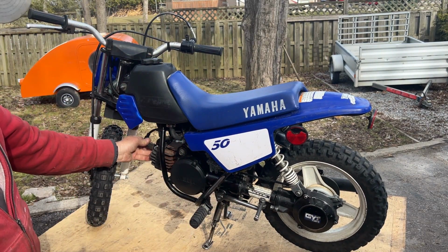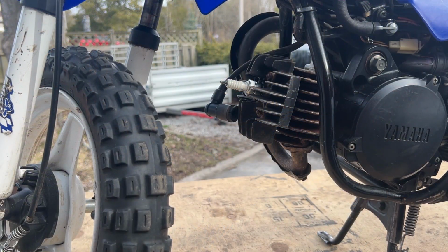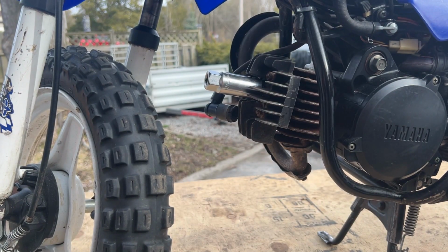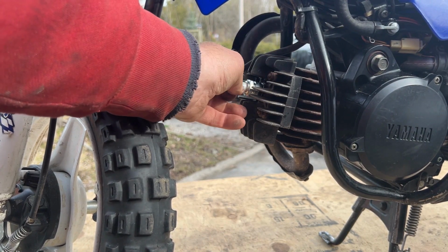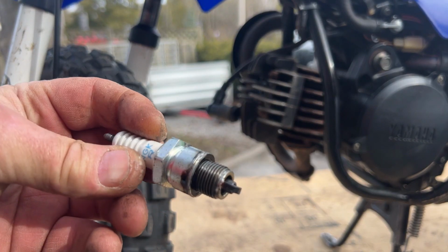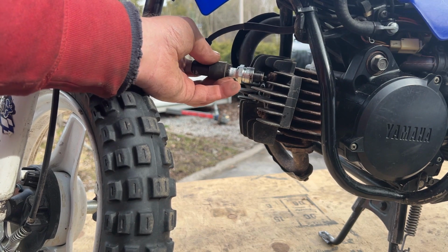Okay. Sparky time. Let's get that spark plug out. Okay, I don't even know if this is a motorcycle plug because most motorcycle plugs are 18 millimeter, and this is a 13/16, which could be the problem. But a spark plug is a spark plug. If it sparks, it sparks. Doesn't look bad. But it is a BPR 4. Let's check for spark.